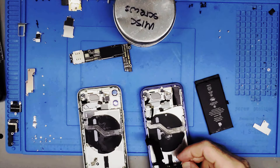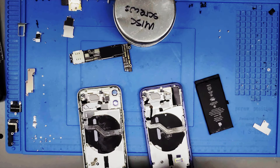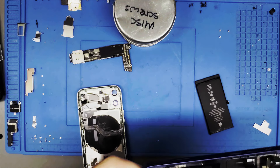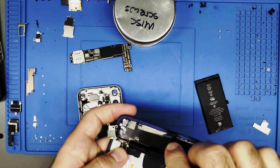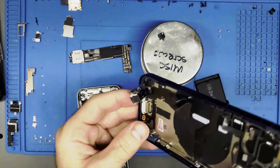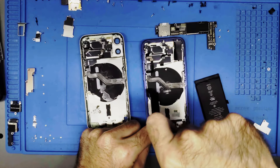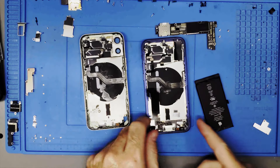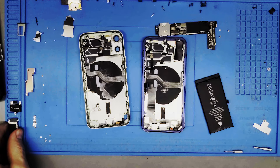Let's see if I can put this back in relatively easily — it looks like a complicated mess. I'm going to start with the charge port and screw that back in place first. There are four holes, two on each side — you have to make sure you put the screws in the right ones, otherwise you'll put them where the pentalobe screws go. This is definitely one of the more fiddly bits because you need to put it all back together in a very particular way.